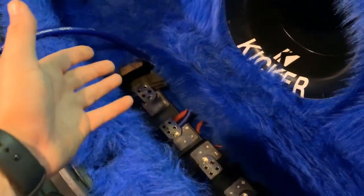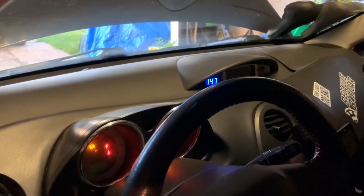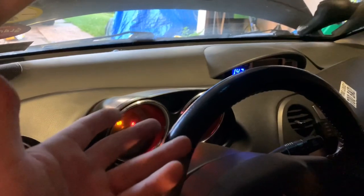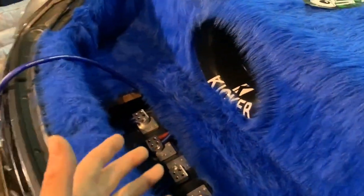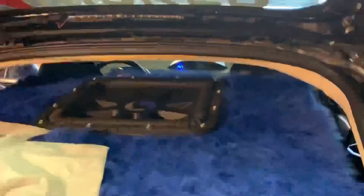I just had that wire run from here to the first battery. I was going to go to the second battery coming from the amp, but I'm not sure it makes a difference - I can switch it if needed. So far my voltage is looking really good at idle, sitting at 14.7, it's charging the lithium. The problem is the voltage will drop as soon as the lithium is quote-charged - at idle I don't want it running at 13 volts, and I have to rev the engine for it to do anything. Hopefully this makes a difference - I'll let it run for 10 to 30 minutes.